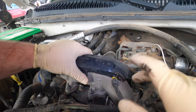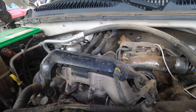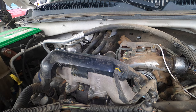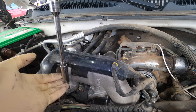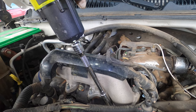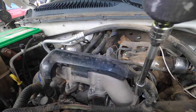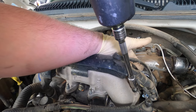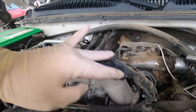Now we can get to the good stuff. We're going to pull this little intake pipe off — it's held on by a bunch of 12s. There's one right here, there's one there. If you ever take these off, I do recommend replacing at least this gasket, because this gasket down here is a multi-layer one and it will buzz. When you get in boost it'll make a buzzing sound when they're bad. I don't like to reuse them, but sometimes you gotta do what you gotta do.